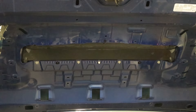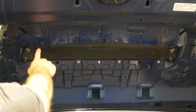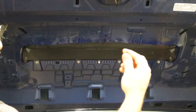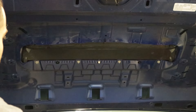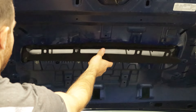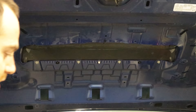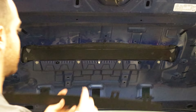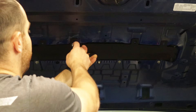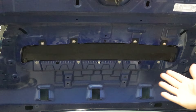This is what it looks like when the duct is removed. We're going to reuse those bolt locations — the ones with the shoulders — but we're not going to reuse the OEM hardware. We're going to place our block-off plate up in there and then use the hardware we supply, bolting it on with a 3 millimeter allen wrench. Just like that, it is installed.